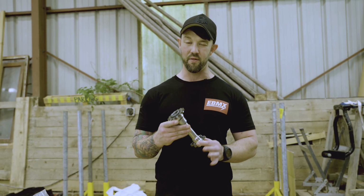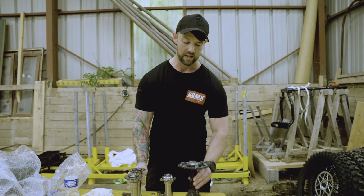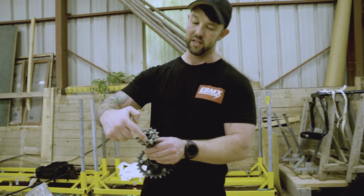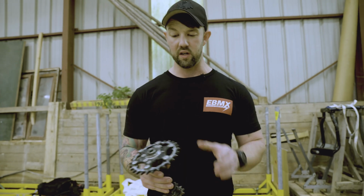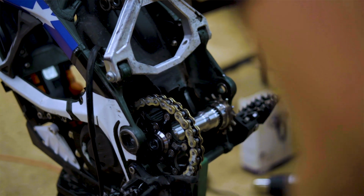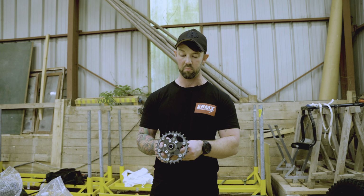What we're doing is talking about the new Ultra Bee Jackshafts we developed for the race series. Originally the problem we had is that we would literally shear the bolts and physically remove this sprocket on impacts. We use the Gridshift Heavy Hitter 520 chain conversion. That actually went through all the series with not a single issue. So well done Gridshift for making an excellent product there.